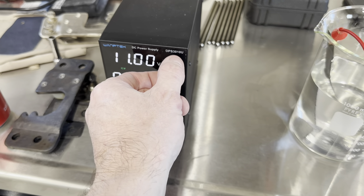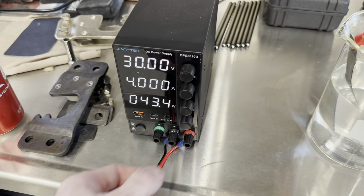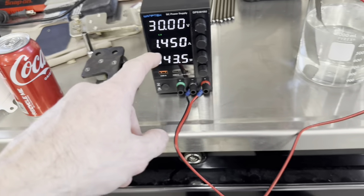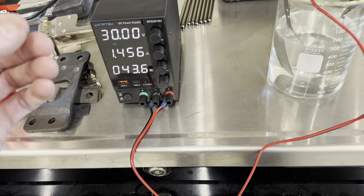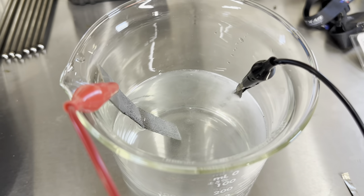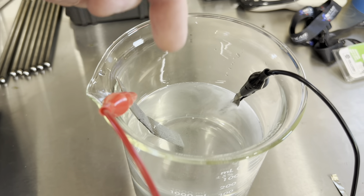When I'm creating a solution I turn the voltage up pretty high, and amperage somewhere around four to five amps. I'm still kind of learning this process so you'll forgive me — I'm sure there's a lot better voltages to set these at. I haven't actually tested this rectifier to see if it's putting out the voltage and amperage that it says it is, so I'm just going by what the display says. Here you'll see the reaction taking place — the bubbles are hydrogen forming, and essentially this is going to dissolve and attach some particles to your negative side while creating a nice green solution.